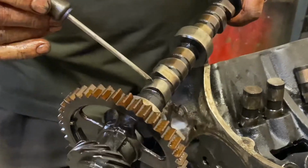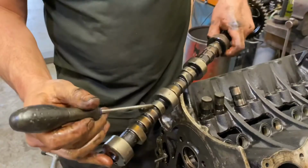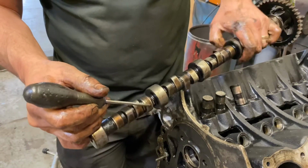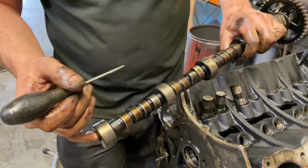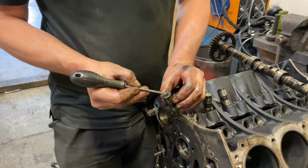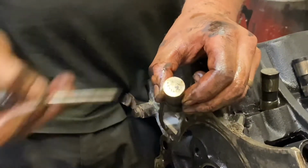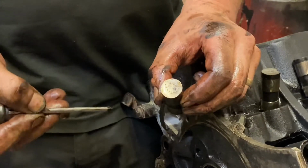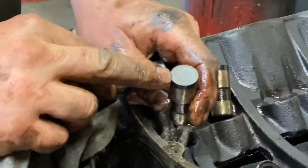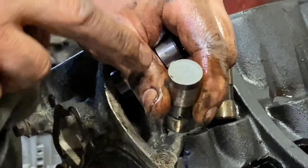This front lobe, you see it? It's clearly looking a bit flat. This one back here, that is an example of severe wear. If we look at some of the cam followers, you can see all these nasty pits here. This is where the follower has worn away and the hard surface has disappeared in chunks. That is a relatively unworn cam follower. I say relatively. The camera probably won't see it, but it is slightly dished.